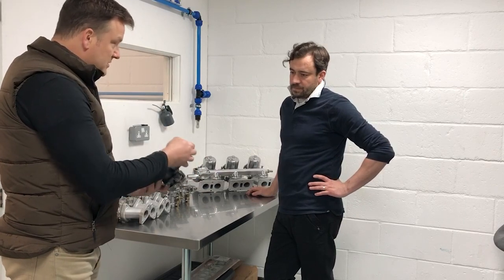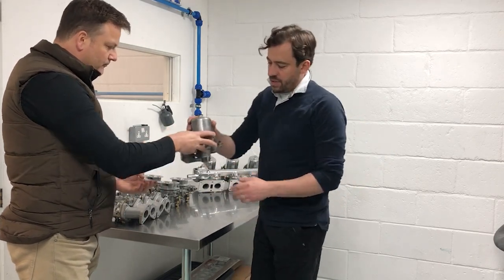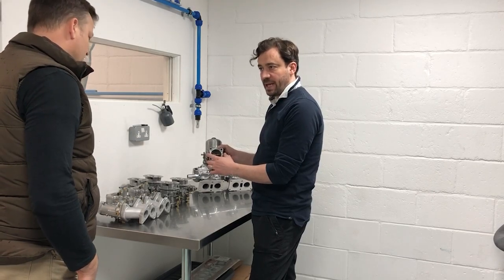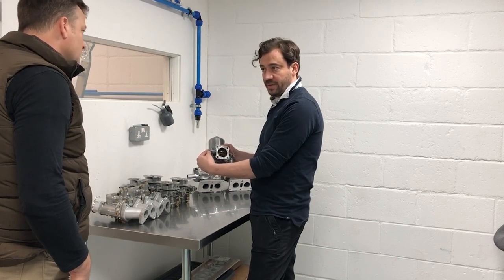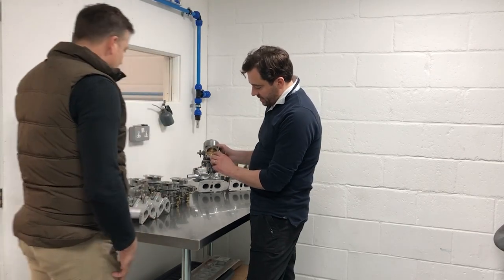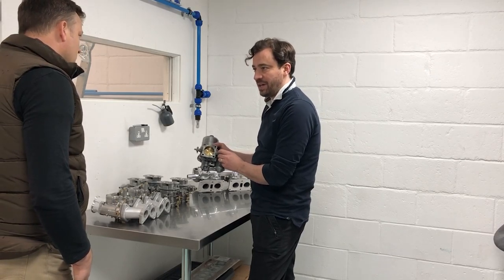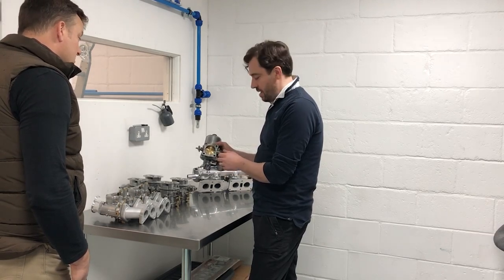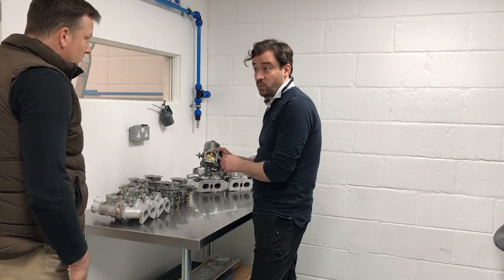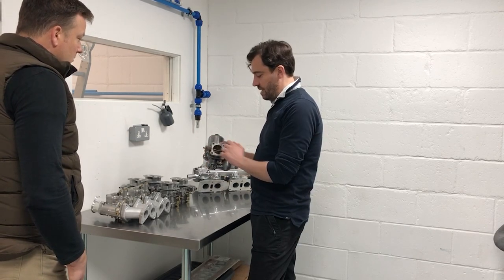I'm particularly interested in the SU because of the Jaguars. How reliable are they and what kind of things tend to go wrong with them? They're a very reliable carburetor. There is a capability for them to wear, particularly in the spindles - there are bushes in here which have to be machined out and replaced if they start to wear. You can feel it in the spindle if it's loose. Of course that will provide an air leak into the intake - it's actually a very, very close fit around there. When it's idling, it really has just cracked a tiny bit off the seat there, and therefore the amount of air that can leak through a worn bush is significant at idle. So if you get an irregular idle, or a different idle each time the butterfly closes, it's either sitting down in a slightly different place because it's worn and there's a notch in it, or it's just allowing a bit of air to bleed through - we see that quite a lot.